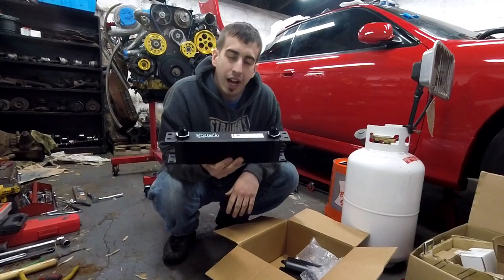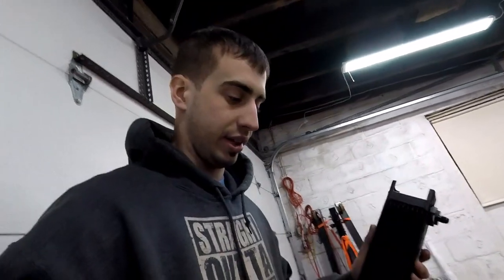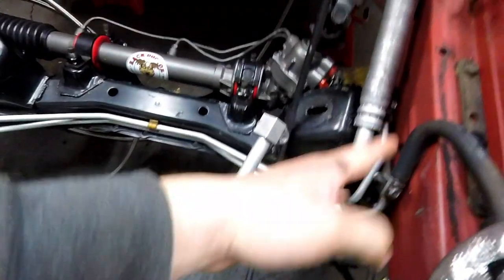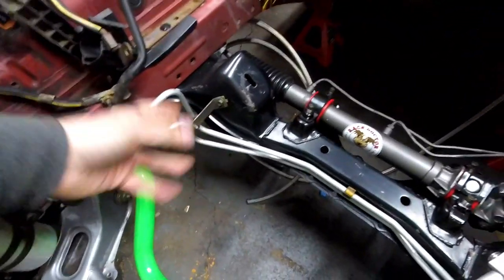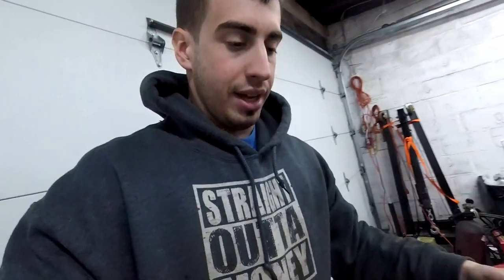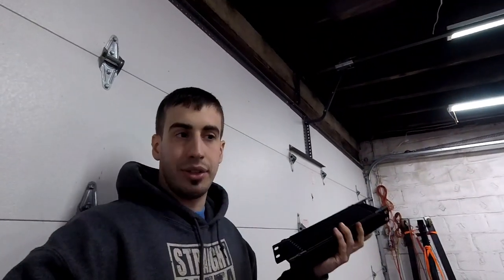Was this cooler needed? I don't really know. Stock cars don't have a cooler — when OEM from the factory, their cooler is this line going around right here. That is technically the factory cooler; wind hits it, it's aluminum, aluminum naturally stays cool and dissipates heat very well. So I'm gonna eliminate that line and toss it — gives me a little more room for my oil pan. I decided to get this cooler; maybe I went a little overboard, but better safe than sorry. At least I know my power steering will never overheat and my pump won't get ruined.